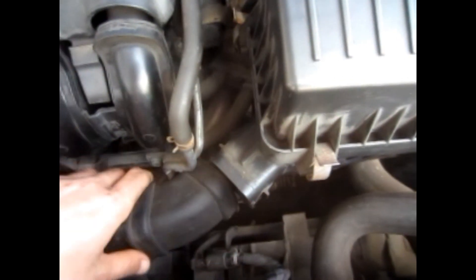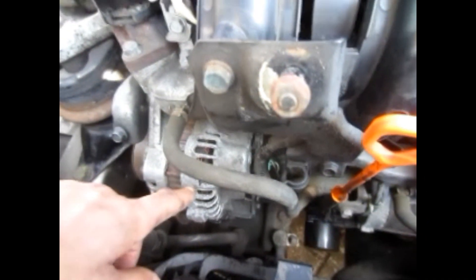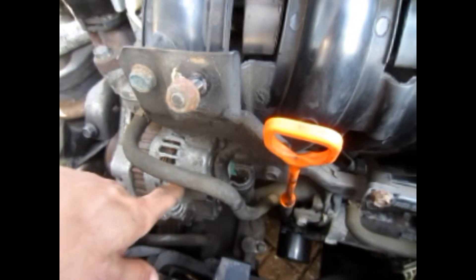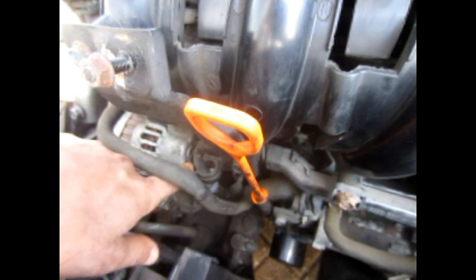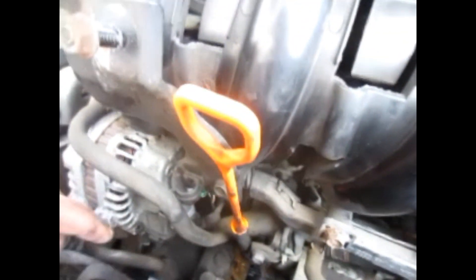There's a little lip here, so you have to pry that off a little bit and it comes away. That gives you a little bit of bare access — you can see the oil filter down there. I unclicked the hose to the EGR. The alternator — I've done a negative voltage drop test, within spec. The B-post is a bit harder to access, but it wasn't really a problem.